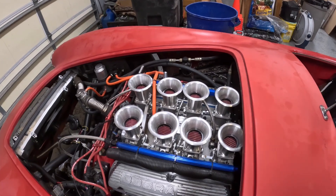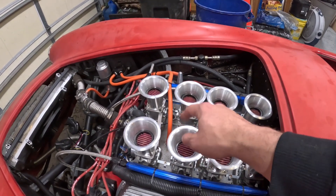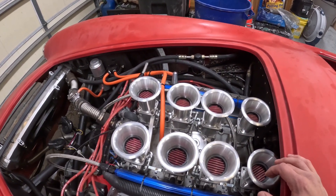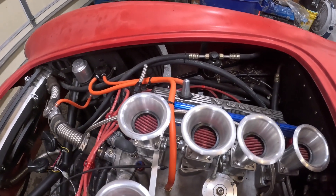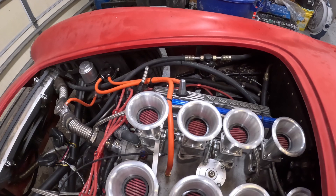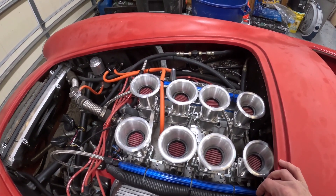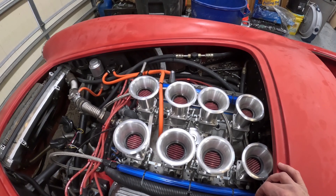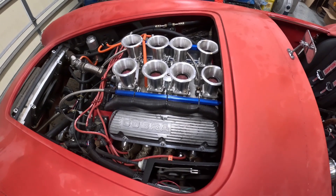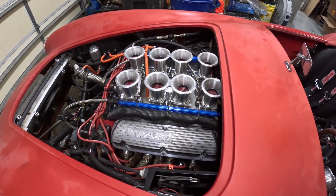A few weeks later, I've gotten to finishing up a couple of these details. I got the fitting needed for making my breather a PCV and got the hose routed — just used a couple of zip ties to get the vacuum hose to the engine out of the way. I've driven it probably 50 to 75 miles like this and it's definitely working well. Valve covers are back on, and the oil leaking that was coming out of them is completely resolved.